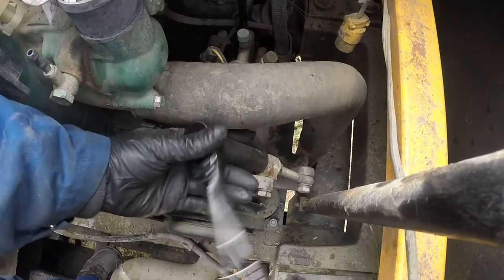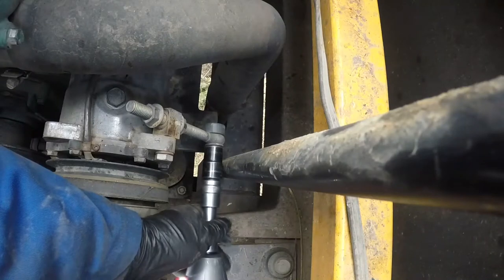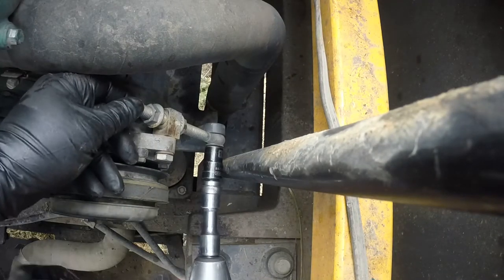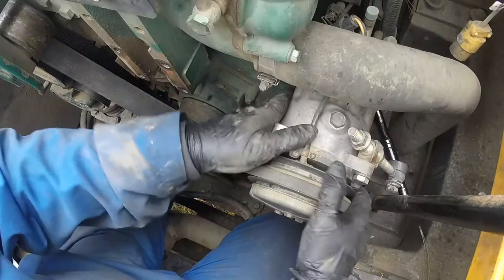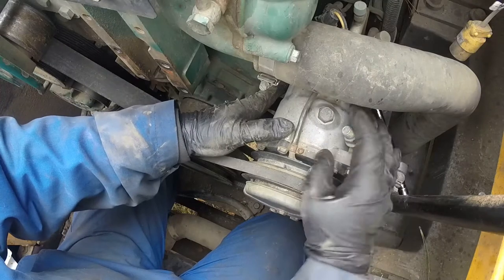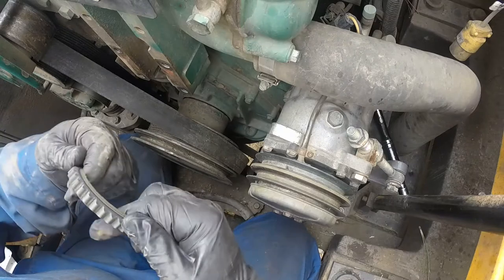Okay, loosen the upper lock nut on the adjuster screw at the AC compressor, and loosen the bottom bolt. We need to make sure it can be moved, and also the two bolts on both sides of the bottom of the bracket. Get those loose as well, and have just enough slack to slide the belt off the pulley. Pretty simple, why not do it when we're right there.